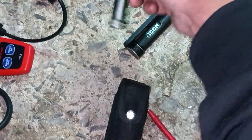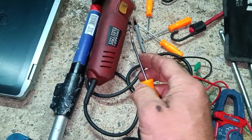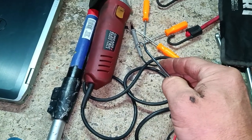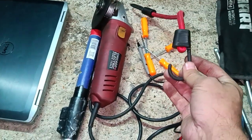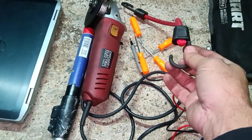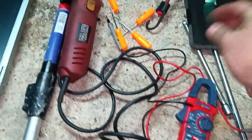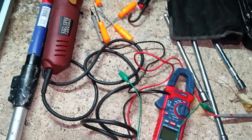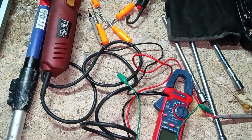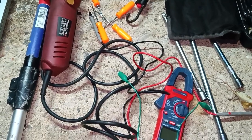The Harbor Freight flashlights have magnets; the little Quantum one has a magnet that kind of works. Also get a variety of hose removal picks — these are for breaking hoses loose from fittings without tearing the hose. Always have a couple of bungee cords for holding up parts. These little jumper wires are great for testing relays, fuses, or injector wires to help diagnose issues.